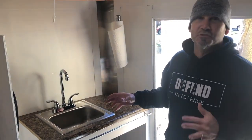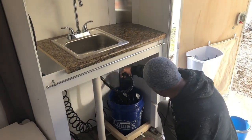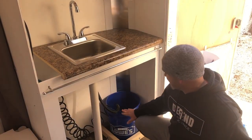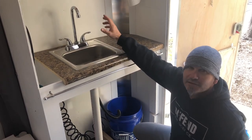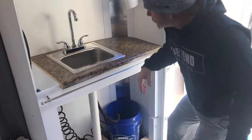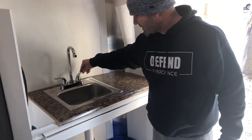What I did — and I saw this on YouTube, which I thought was a fabulous idea — is I've got a fountain pump down in here. This bottom is a fountain pump sitting in a five-gallon bucket right now, just for using temporarily; we'll get a nice clean one when we start. The pump is actually fed into the water line here. We do dry camping, so we have no hookups or anything like that. The idea is just with the power and the solar, we can actually turn that pump on and the water comes out.